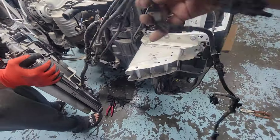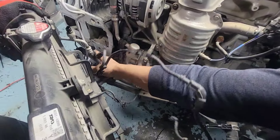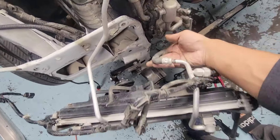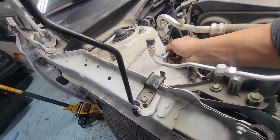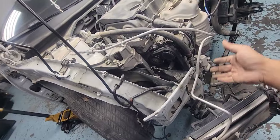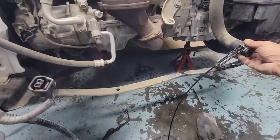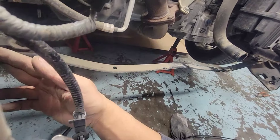There we go — the harness is dripping coolant. Because the AC condenser is connected here, we're just going to swing it over to the passenger side. Be careful with the AC lines — this is the low side, and this is the high side. Just swing it over; there's not much tension on this line, but you can bend it quickly, so be careful. We don't want to leak refrigerant. This section here is bent, so I'm assuming the undercarriage is bent as well.